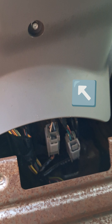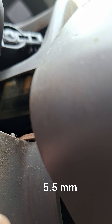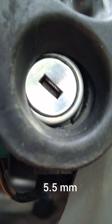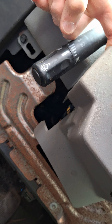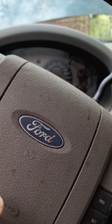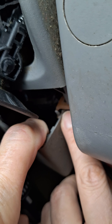The next piece to tackle has a little nut right here and some clips to release it. This screw is a 5.5 millimeter, and when you come up here there's another screw under this panel — also a 5.5 — and around on this side there's another 5.5 screw as well. If you can lower your extender arm to raise the steering wheel, you can take this panel off. We're trying to do this without having to take out the airbag inside, so we'll work around these pieces to avoid breaking the brackets.